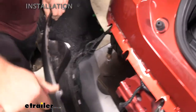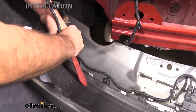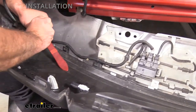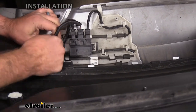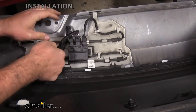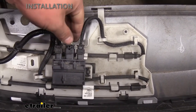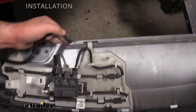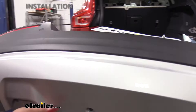Before setting the bumper aside, you'll see the wiring continues along it, so pop those remaining clips off just like before. Tilt the fascia back slightly to work your way down. Take your time with the plastic clips — you don't want to break them as it may prevent the wire from seating tightly on the fascia later. Once all clips are removed, you can remove the center plug, which will finally free the rear fascia. Set it in a safe spot, such as on cardboard or a flat table, so it doesn't get scratched.